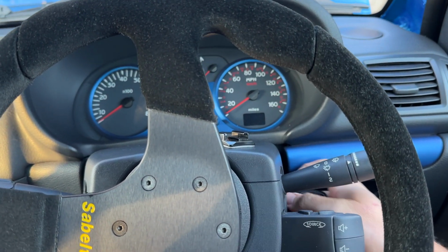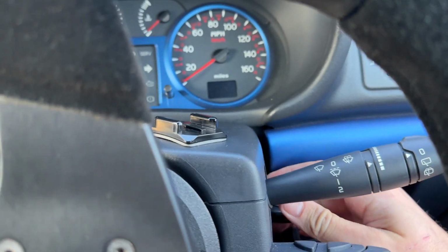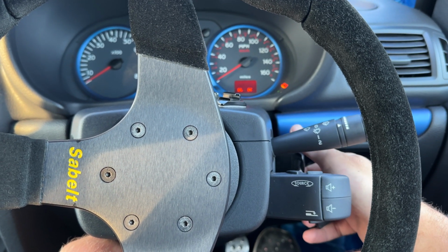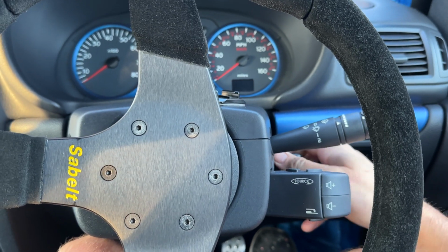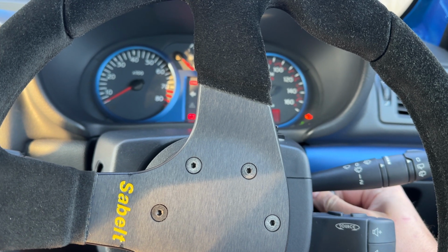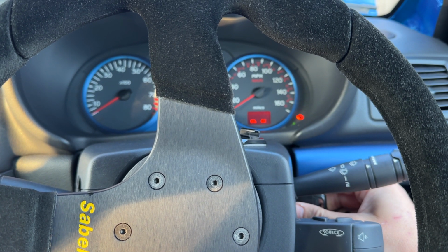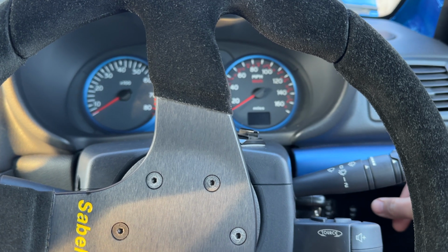So the first job is to prime it, and the reason we do that is because we've had all the fuel rail off, and you'll get like a hiccup and a misfire as it tries to go, as it's priming and starting at the same time. But honestly, I just do a couple of cycles. Listen for the pump. And then what we'll do is go back outside, make sure there's no leaking on the fuel rail, because we've plugged that back in and sometimes those O-rings do split.